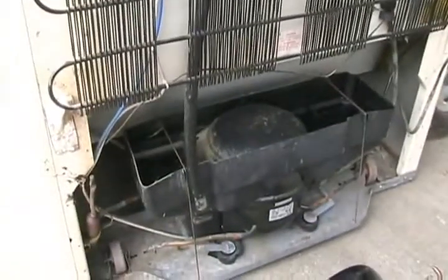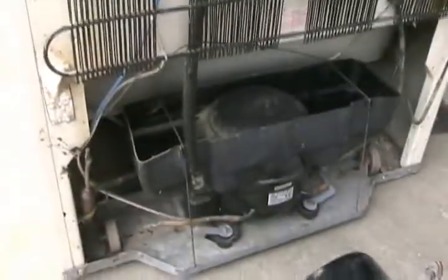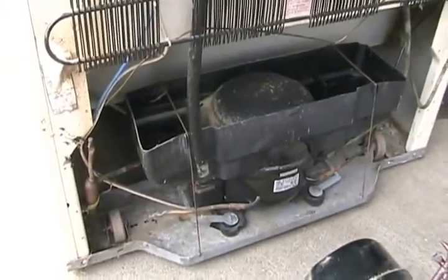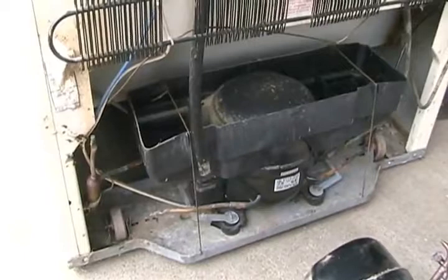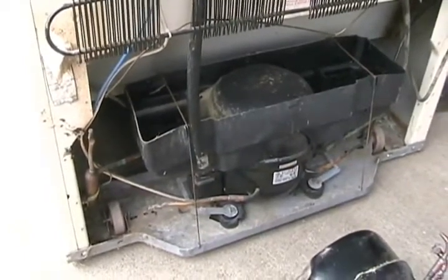If the compressor's really hot when you touch it, and the fridge hasn't been running for a while, it's probably a bad compressor. Still, one of those other components could have failed. If you just hear it going click every few minutes, it's probably a bad compressor. If it's a capacitor model compressor, it could just be the starting capacitor.